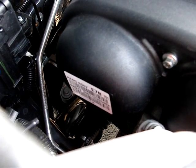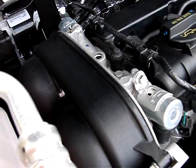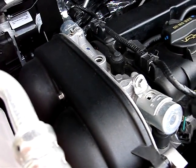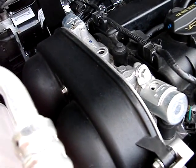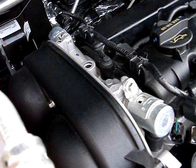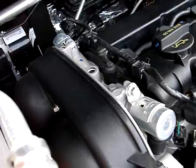Just a note that these cars do not have timing chains — they do have timing belts. It's a 150,000-mile change interval though, so it's not like you're gonna have to worry about it that often. It's not a 60,000-mile interval — one of my friends had an Aveo and had to change the timing belt at 60,000 miles, and I thought that was bad. But again, belt-driven not chain-driven, so you do have to change it.